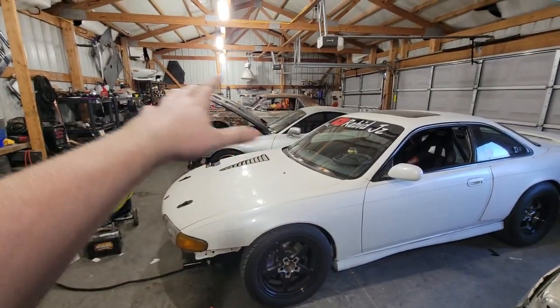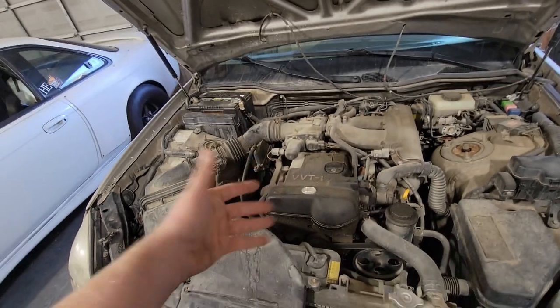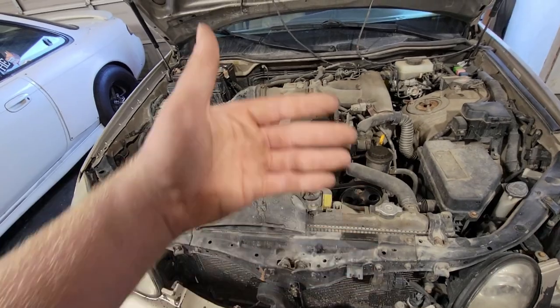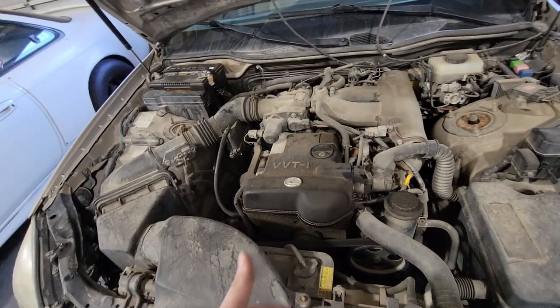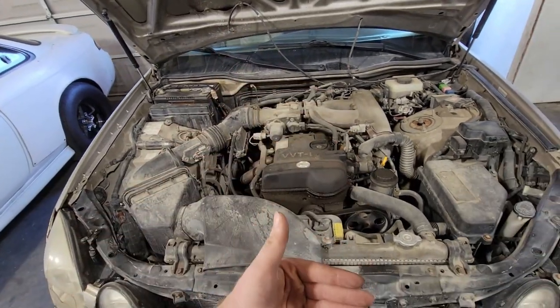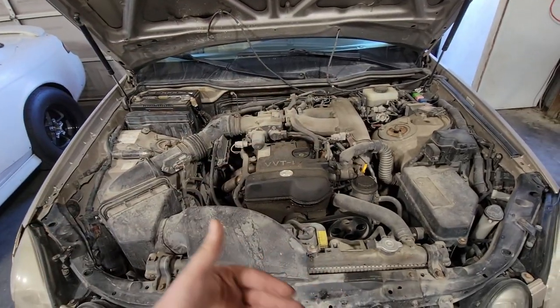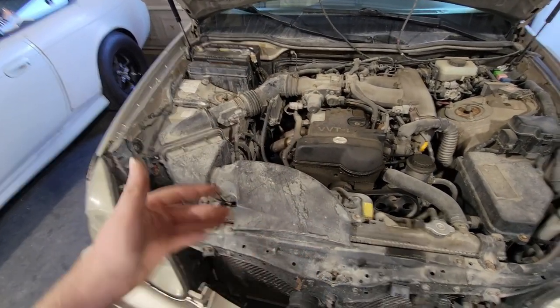For those of you following me who are into JZs or have a big dream to have a turbo car — some sort of boosted JZ kind of like my supercharged 240 — and you're watching to learn, I'm also assuming there's probably some of you who have never actually torn into your engines before. I'm going to go over a quick deal on how to tear apart the front of the engine, because I will be removing the timing and replacing the cam seals as well as the crank seal. This is a very simple procedure on VVTi engines.